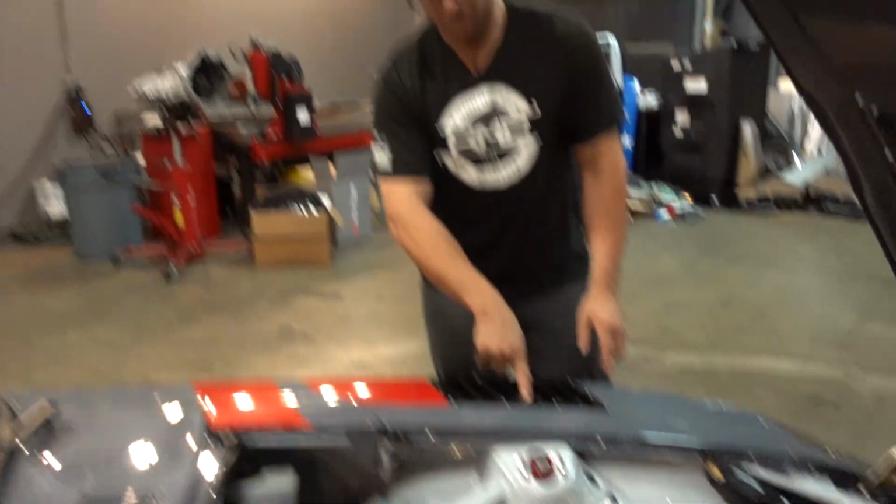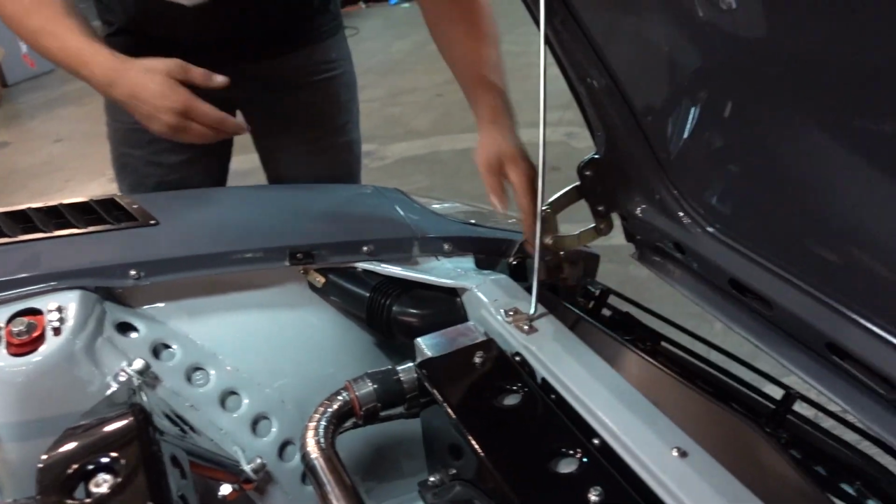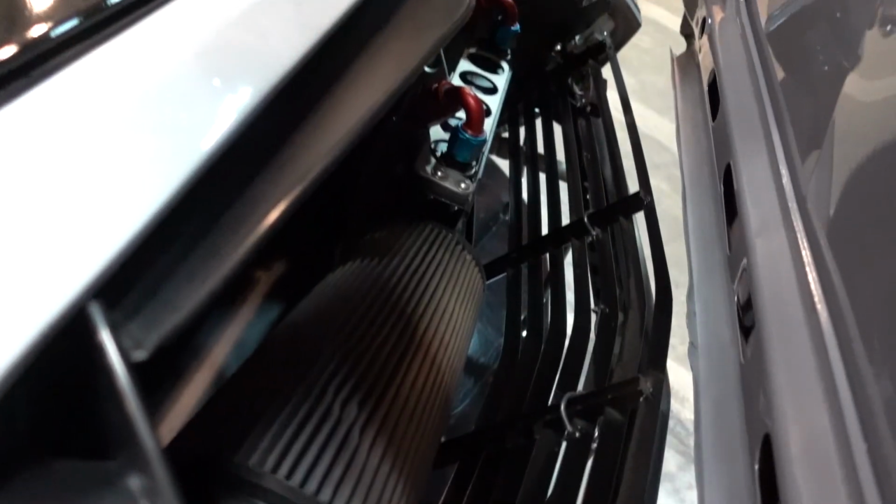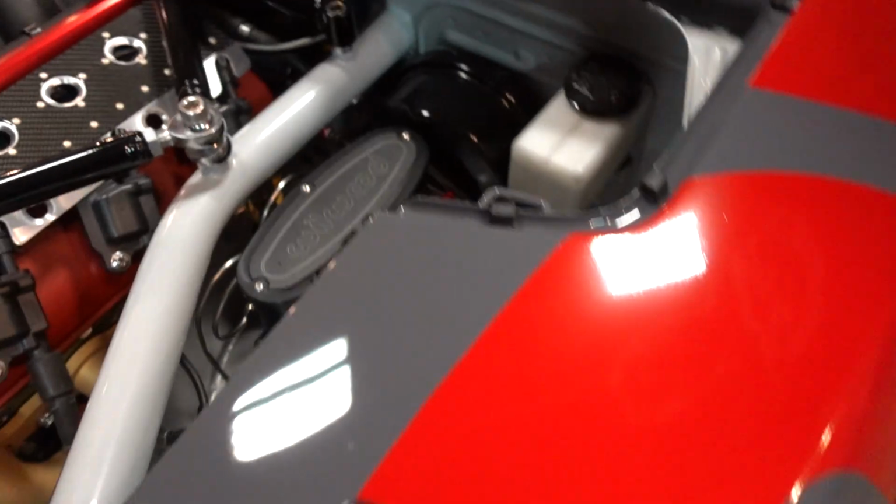And these are your fresh air vents? Yeah, these come in through the front near the radiator. And then is there a tube that kind of follows along through the fender? It goes through the actual factory unibody structure. Yeah, the whole front is sealed to the hood. It's widened to catch more air, and then I just welded on these scoops that go right to the vents, and they work awesome. You can see all the bracketry and stuff.